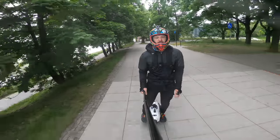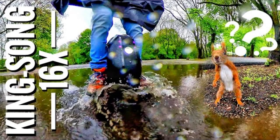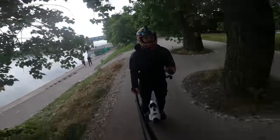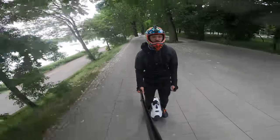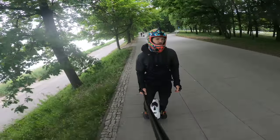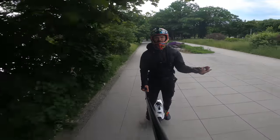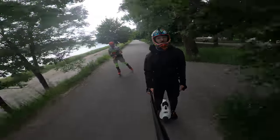Let's start with the KingSong 16X. I've stacked around 500 kilometers on it, and when I opened it up it was quite dirty inside. There are points of ingress: water can seep in through the trolley handle, through the front light element where dust and water can build up, and through the rear speaker grill. It won't kill the wheel from a short rain ride, but you need to clean it occasionally. My best advice for the 16X is to put a plastic bag over it when riding in rain, and possibly cover the rear speaker.